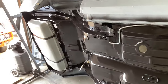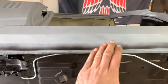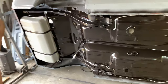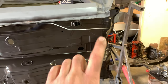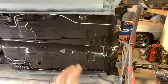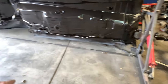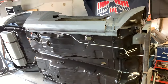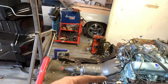Now you can do painting, run the lines, any kind of body repair, welding, patching of the floors — whatever you want to do. With that being said, this design only works if you've got a strong enough car body to not twist and fall apart — rockers need to be pretty solid, frame rails obviously need to be in place. This is not necessarily a rotisserie for heavy metal work. Any major structural welding, I wouldn't recommend a rotisserie of any kind — keep it square to your frame jig or level it to your shop floor using a bubble level to make sure everything is square.